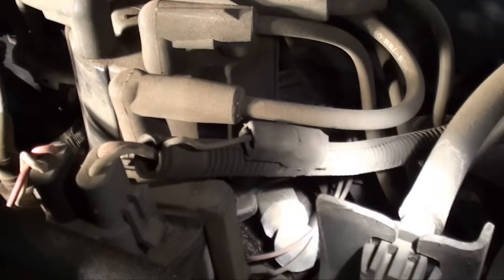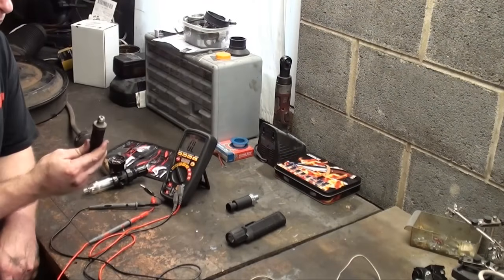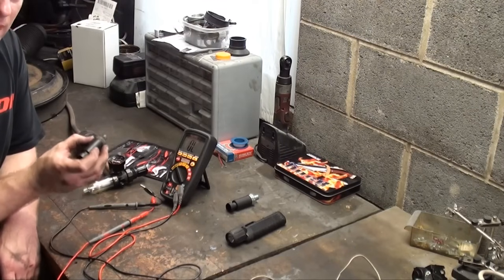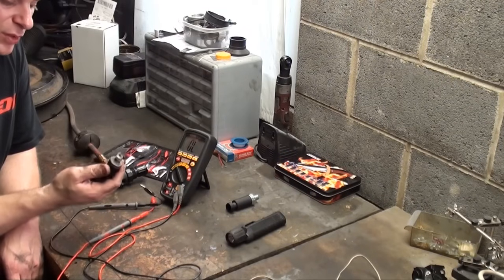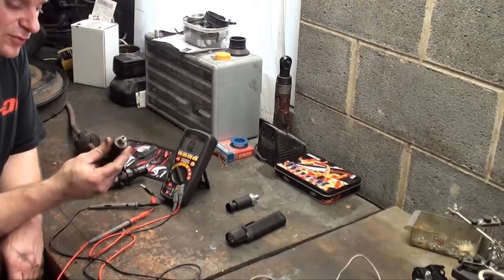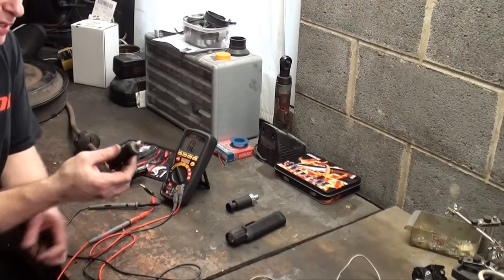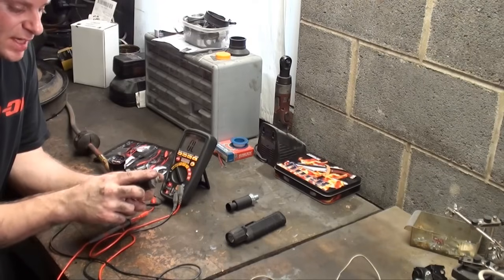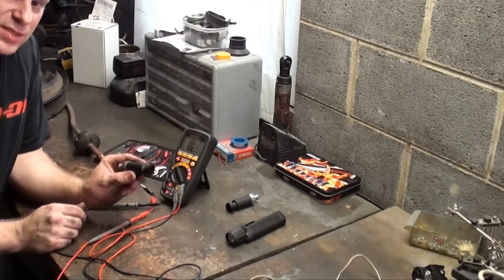You can just come down right behind the distributor and you can see that's where that oil pressure switch is located. Okay guys, I'm back over at the bench. I got the old pressure switch removed from the vehicle — it wasn't too bad to remove. It does require a special socket. However, if you have an inch and an eighth open-end wrench, you can reach down there and break it loose, or a pair of channel locks, or some means of grabbing a hold of this nut, breaking it loose, and then you can reach down and simply unscrew it by hand. It's an NPT — it's a pipe thread, a taper style thread — so once you break it loose, it'll get easier as it goes. So let's bench test this one and see what we got.